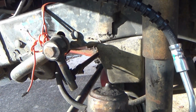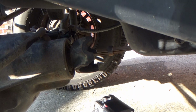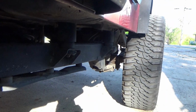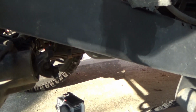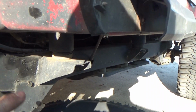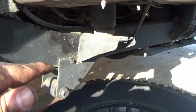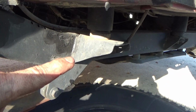Now, just in case it got caught up in the camera shots, look right there. Yep, you're right. I'm not running the front drive shaft. Why am I not running the front drive shaft? Well, because that rear differential right there came out of rust bucket, and there are two different gear ratios. The rear end on this thing, I think in my last video I said something to the effect of that rear end there being a 3.73 rear end. It's not, it's a 3.55 rear end. The 8.8 that's under rust bucket right now is a 3.73. So that's a 3.55 rear end.